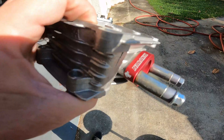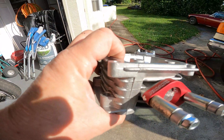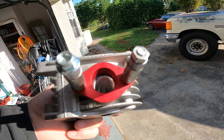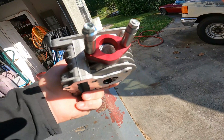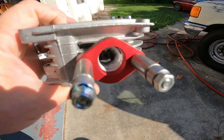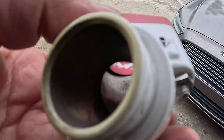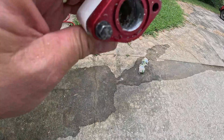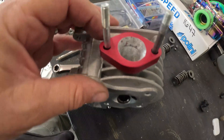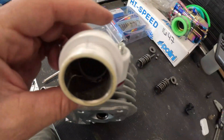I got this Naraku spacer for a big bore kit, but I'm going to use it on this and swap it later when I get the big bore kit. Now I'm trying to port-match the head to that spacer so it all flows smoothly — getting rid of that bump right there. Then I'll bolt the spacer to the intake manifold and do the same there. Now you can see it all kind of flows in there evenly. There's a lot of rough stuff inside the intake I can smooth out — little bumps and grooves. There's a big ridge where it turns in; that matches up a lot better now. The intake is definitely more matched up; it all flows in there nicely, and this does too — a nice smooth transition for the air.